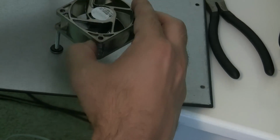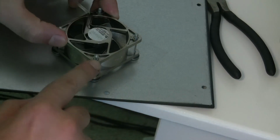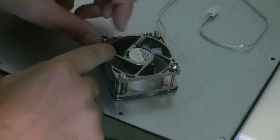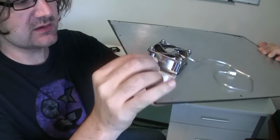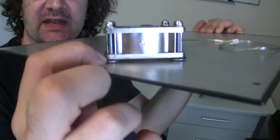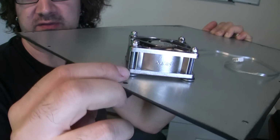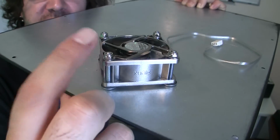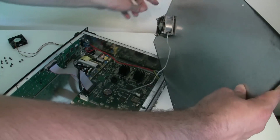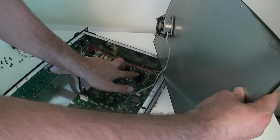Now we can fit our fan, and we have space to put our bolts. The new fan is tightly secured, doesn't move, and these little new rubber bands, the smaller ones, are going to make this fit properly so that the bolts can fit on the screws. Make sure that you're putting back the panel the way it should be. The fan should be facing these two processors.